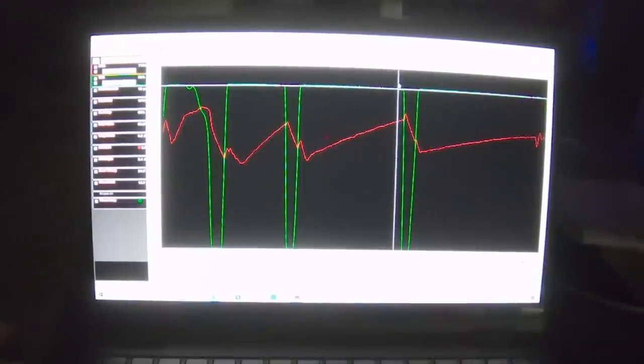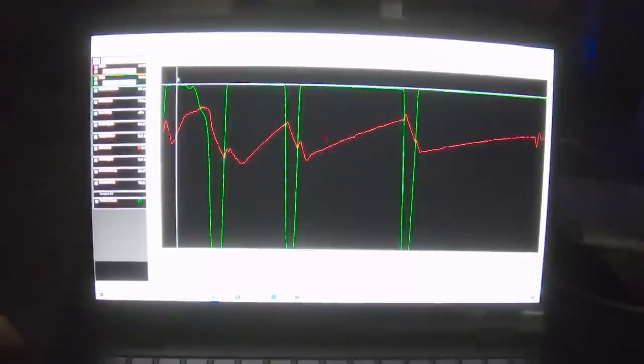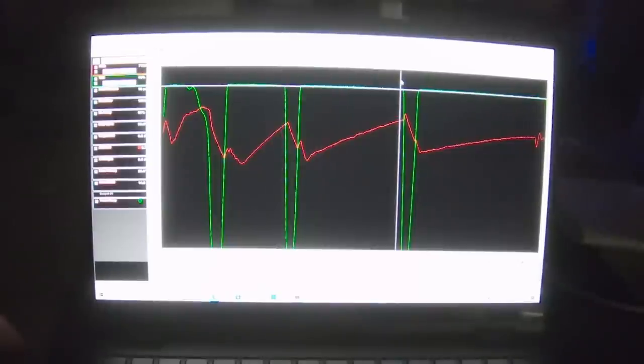And the engine makes peak power, I'm guessing, at about 7,300. I wasn't there on the dyno, but they revved it to 7,000 and said it was still climbing. So first gear, I short shift, but second gear, I run out to 6,700. Third gear, I run out just above 7,000. Then I click it into fourth, and it's pulling, but it's not pulling great, okay?